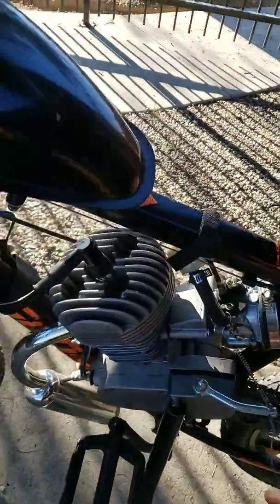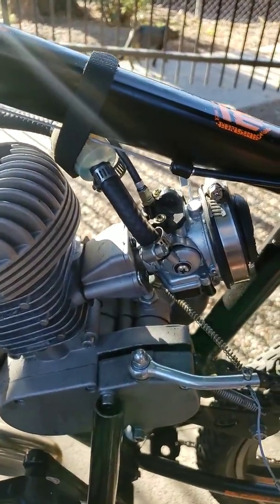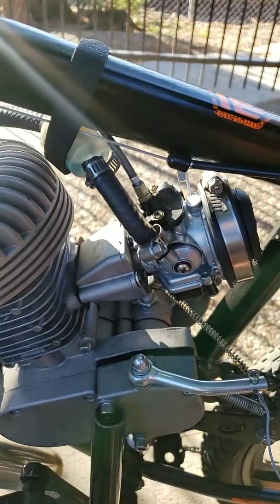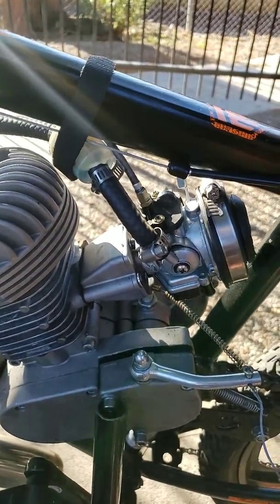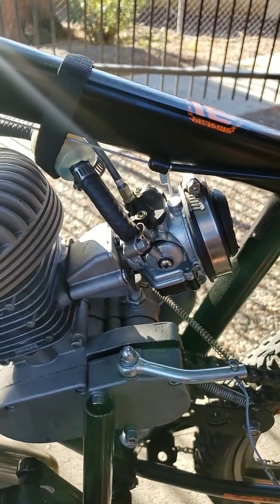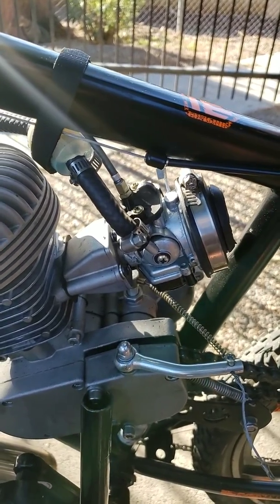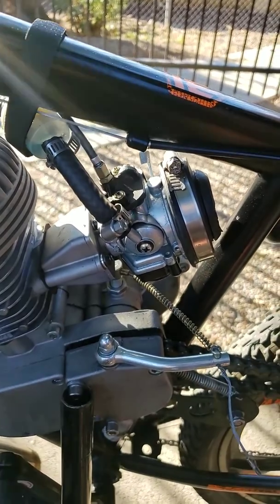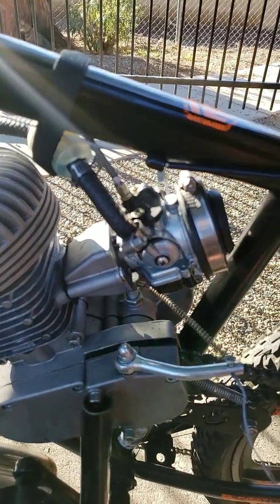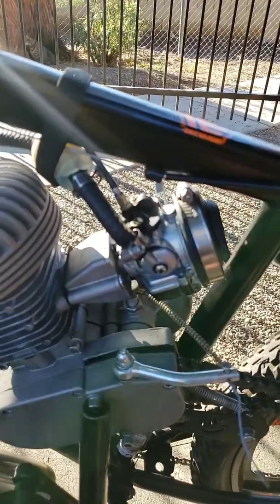And what I did for the carburetor, because I kept getting a vacuum leak in the carburetor, and I tried the electrical tape that someone suggested to me. All that did was crack the insert, which is actually a shim, and it's a 1mm shim. So I looked online and found a place called Treatland that sells a lot of Dellorto parts and Dellorto carburetors, and I actually got a Dellorto 1mm shim, and it looks way different. It's like a white color. I think it's made out of Delrin instead of plastic. That's my belief. And I put that shim on, no addition of electrical tape or whatsoever, none of that. Put that on, and it runs perfectly. It idles down when I pull the clutch, and it runs beautifully.